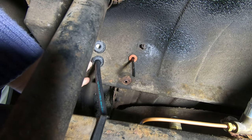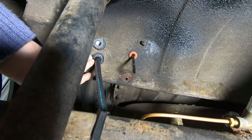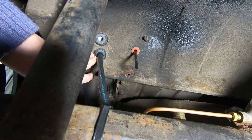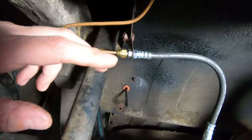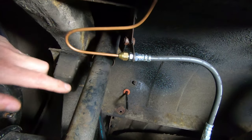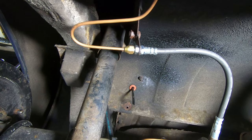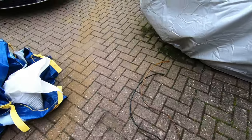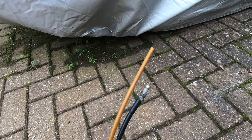This is really quite awkward - I've jacked the car up a fair amount but I should have gone higher. There's not a lot of room under here, hence it's been painstakingly slow trying to get to everything. But I think I've got everything off. The fuel pipes are clamped to a bracket and then run forwards along the sill to the reserve tap. These are the two pipes I've removed from the car - this end goes to the tank. I've cut one of the connectors off and the other one is on. These are the original pipes.